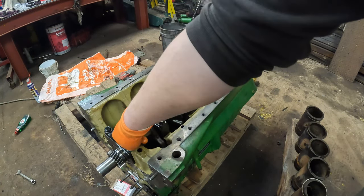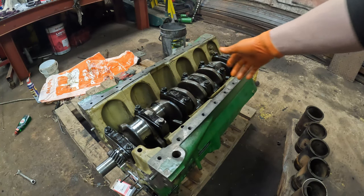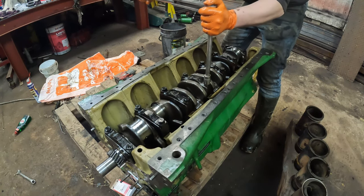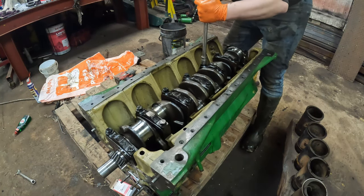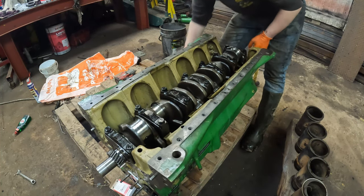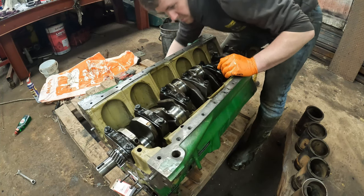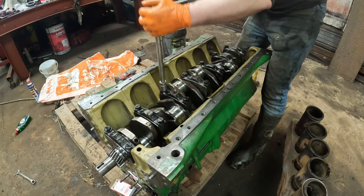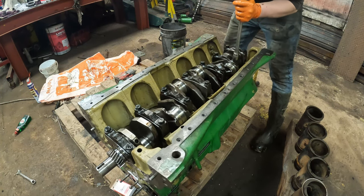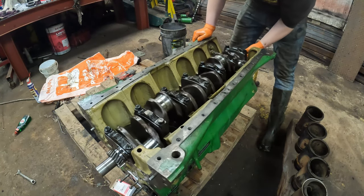They're all in, all the top caps are in as well. Obviously the shims on the inside, I've finger tightened all of them. This one I have literally just torqued down, 120 newton meters. So obviously I don't need to do that one because it's tight. And then all the time after you've done each one, just make sure it spins freely. Because if it doesn't, something is binding somewhere, and you'll be in a world of problems. I literally just didn't do what I was supposed to do. Right there. Yeah, that spins freely still.